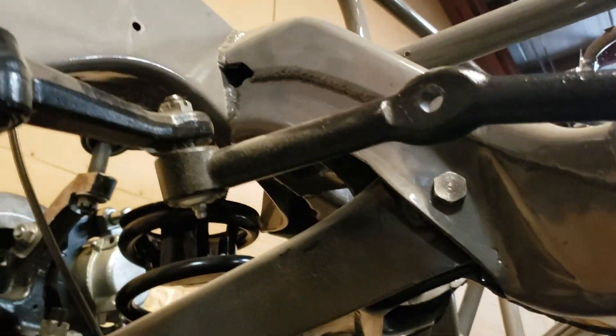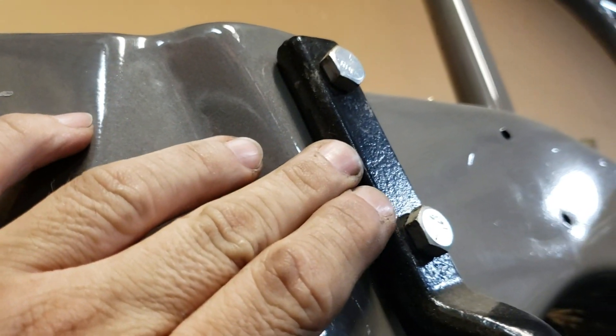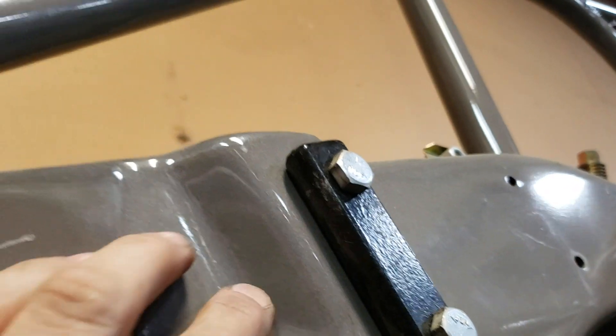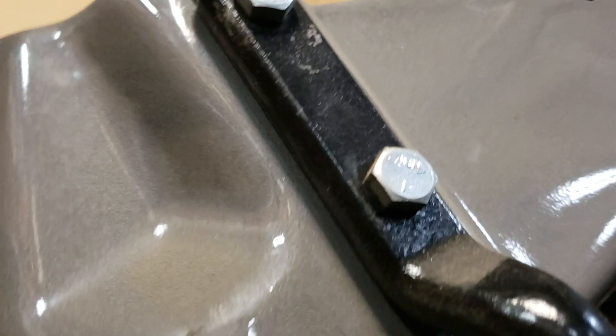Some of the things you may encounter is right here in the chassis. We may have to put some washers right here, move the idler arm over, or in some cases I've seen it where we've had to take a zip wheel, cut the frame down through here and cut the frame down through here on that side, push it in, and re-weld it.